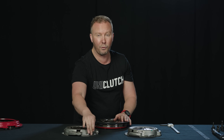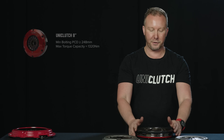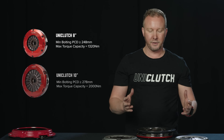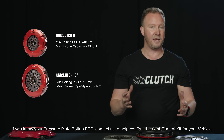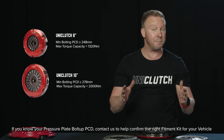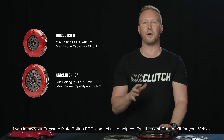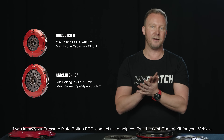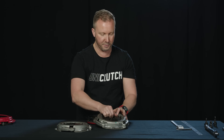So provided that you've got at least a 248 millimeter bolting PCD, you know you're going to get a flywheel mount and be able to put a UniClutch core in. We've also got a larger UniClutch available in the range — if your factory clutch is 10 inch, or with a bolt-up PCD of 278 millimeters or more, you'll be able to fit the larger UniClutch which holds even more torque. So just decide whether you're in the 248 to 278 range or 278-plus, and I'll show you how to measure the PCD of your factory clutch in case you're unsure.